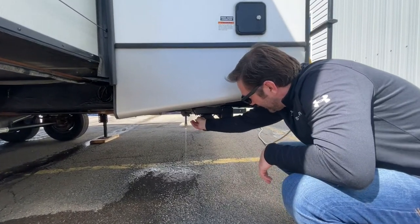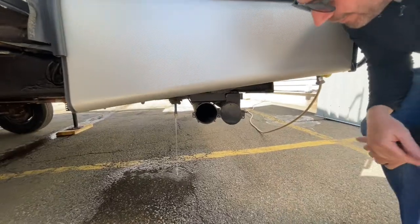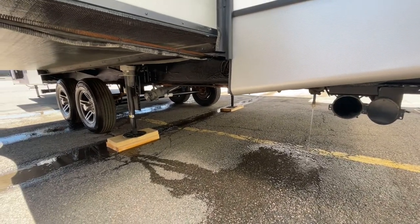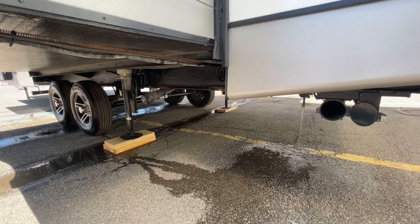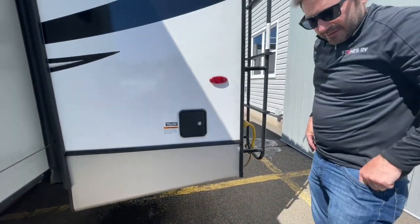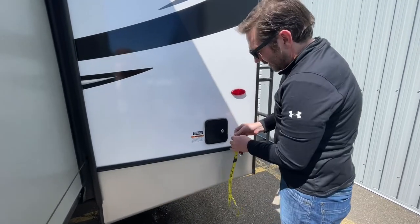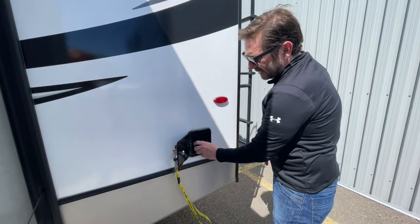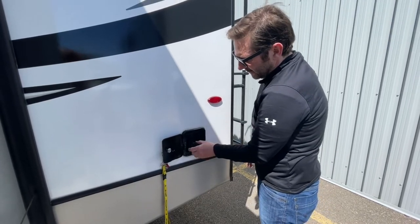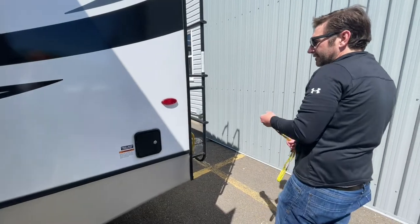Here is where you're going to store your septic hoses. Your septic hose will go in there. You're going to need two septic hoses into a Y, and then the Y is going to connect to another hose into your septic bed or at the campground. Here we have the fresh water connection. The hose doesn't exactly connect to this — you just set your hose in there, and once water comes out, you'll know it's full. When the tank is full, that is when you're going to use your water pump. If the tank is empty, don't turn on your water pump.